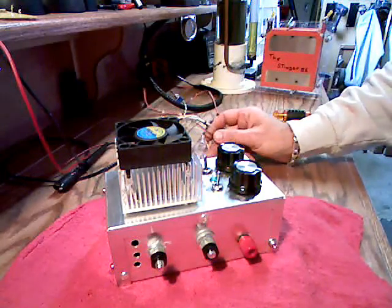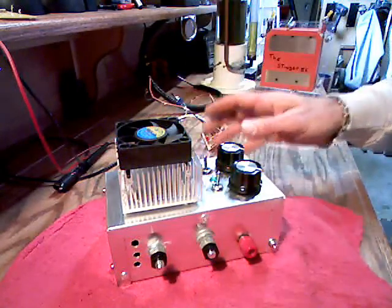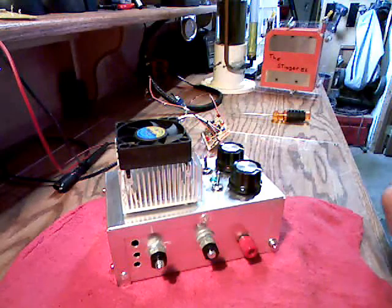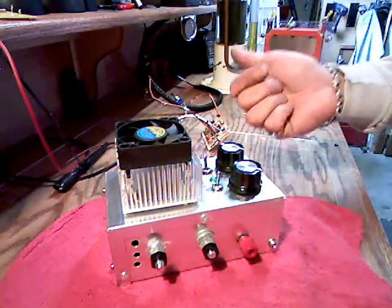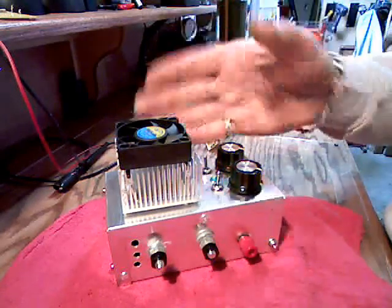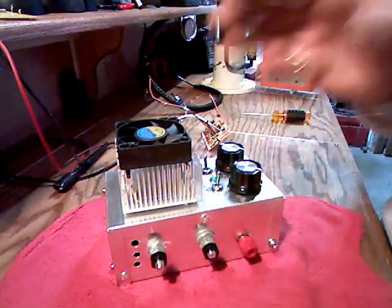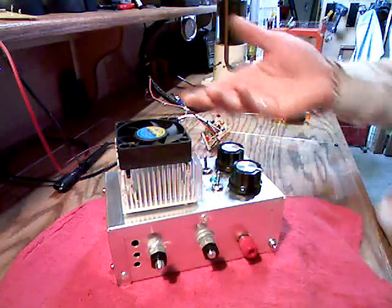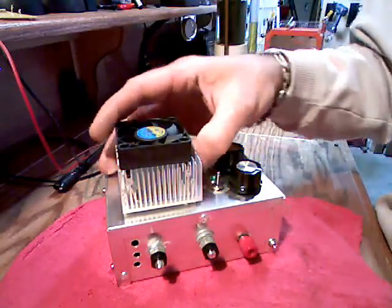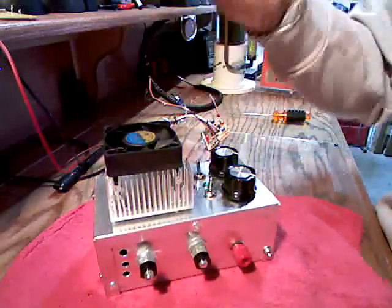That's why I've been pushing more on the O2 and MAP sensors. But I think we need to control both. The computers in these vehicles are smart enough to realize that if the MAP sensor says we have this much going in and the O2 sensor doesn't agree with what the MAP sensor is doing, the computer is going to default back to factory settings. So if we can control both of them, keeping them in line with each other, we'll start noticing a difference — burning at 100% efficiency. That's my goal.